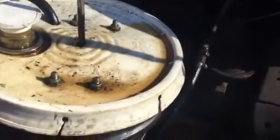Pressure, because when I crank it and feel the hose, it expands. So we're getting more pressure to the bearing. So we got oil to the bearings. Next, make sure the throttle and shutoff mechanisms are free. Let's see. That wind noise is probably really bad now, but the throttle is free. The emergency shutoff is working. I primed the oil system, pressurized it, and I made sure the valves and injectors were free.